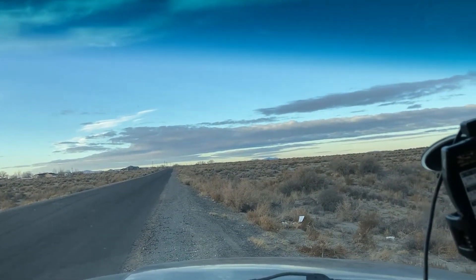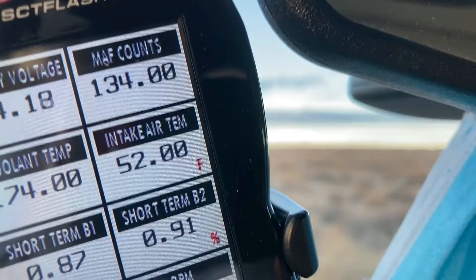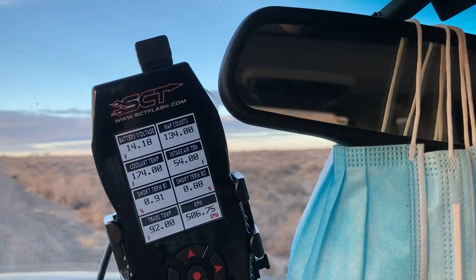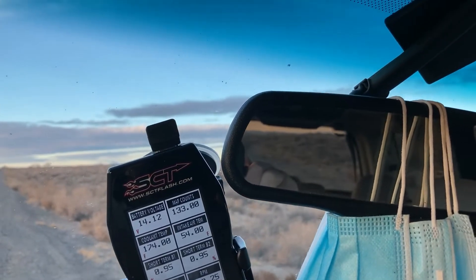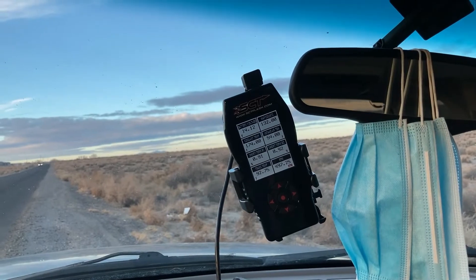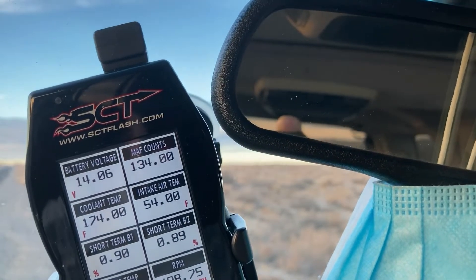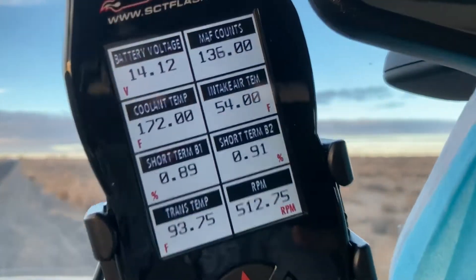There's actual data on my intake temperature. Now that I'm just sitting there idling on the side of the road, it went up a couple degrees. But when you're driving, the intake temperature on my truck after I did my intake mod is the same as the outside temperature. When you stop, it'll raise a couple degrees, which is no big deal — because all cars will have a higher intake temperature when sitting in traffic. But if you're driving, my intake temperature is exactly the same as the outside air with the modifications I have done. Hope this video helped clear up the air for those of you who thought I'd have a hot air intake — I indeed have a cool air intake while driving. There's the proof; it's in the data.